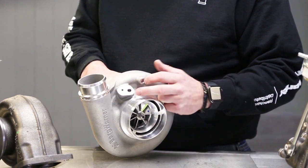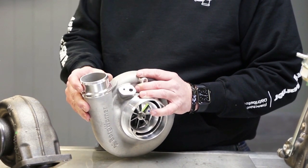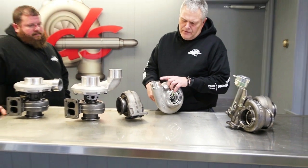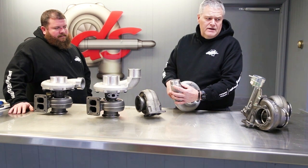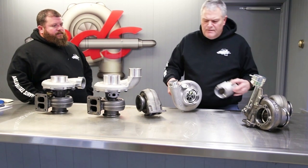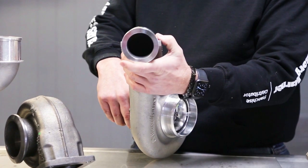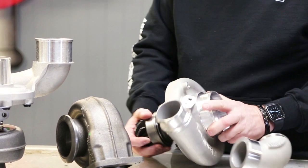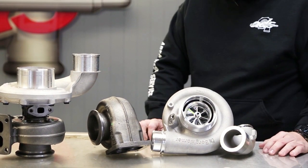There are instructions on how to drill these holes out to make them active if you choose to use them. The compressor housing discharge design, as you can see, is much smaller than either of the other S300 compressor housing discharges. It's also made so you could cut or machine this hose barb off the end and have a V-band flange on the end, where you could then put a different elbow or adapter onto it — such as a 90-degree elbow, similar to this turbo made for the John Deere application. But all the robustness in those met all OE requirements and stringent testing that Borg Warner has done.